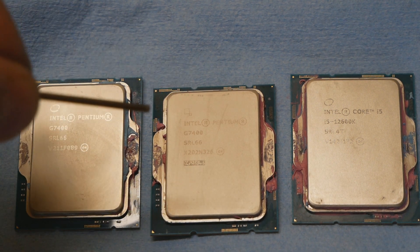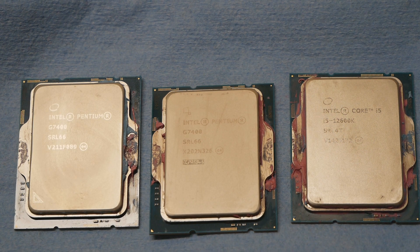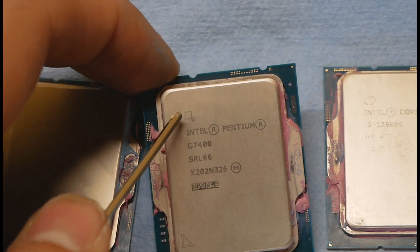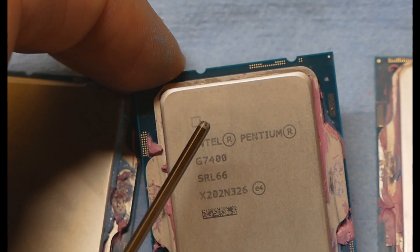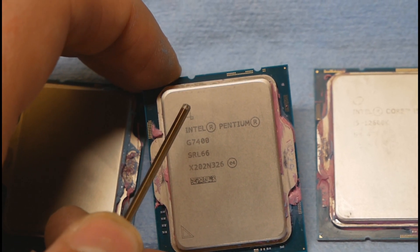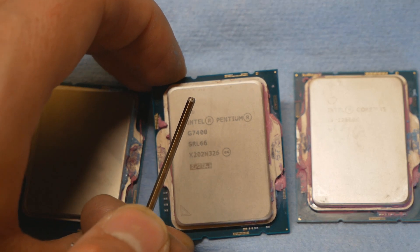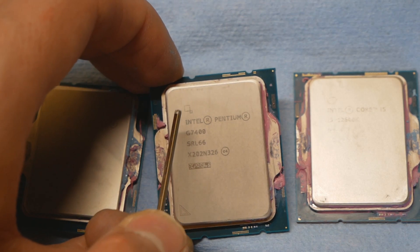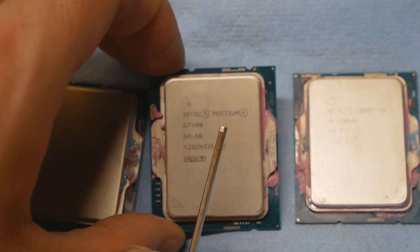Here in the middle is the G7400 I used on that video — the worst one; the better one I sold to my team member Clemens from Germany. If you look carefully, it has a rectangle over here on top of the Intel text. That rectangle or square-ish marking means that the AVX512 instruction set has been disabled at the hardware level from this particular CPU. This is the very same CPU that's on the thumbnail of my original video. If the CPU has this rectangle marking, there's absolutely no way to get AVX512 to work as it's already disabled by Intel at the factory.